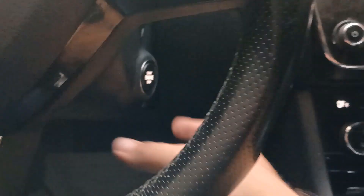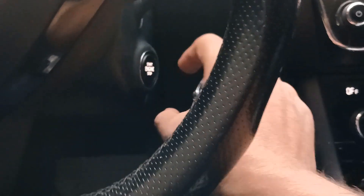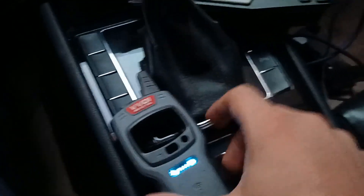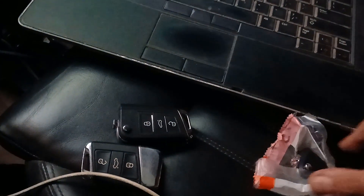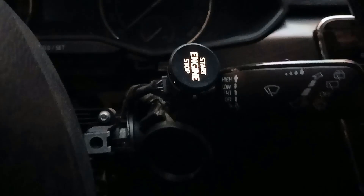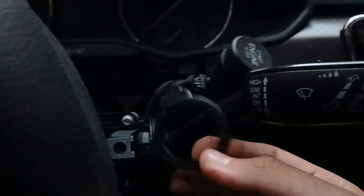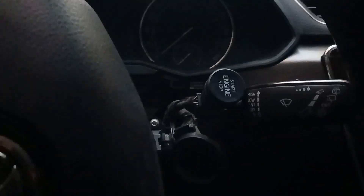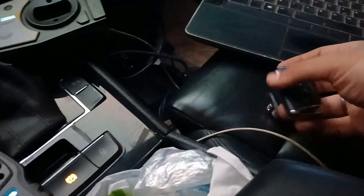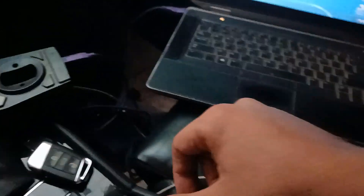I don't know what's going wrong. Maybe I have to disassemble this cover and the switch itself, get the coil out, and insert the key inside it. Now using the VVDI Mini Key Tool, I prepared this one for the newer version as shown at the beginning of the video, and now it's assembled. Here is the start-stop button and here is the antenna coil. If I press the start-stop button, the car starts because the original key is still inside the vehicle.